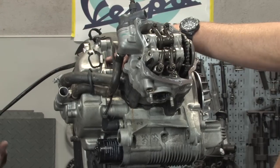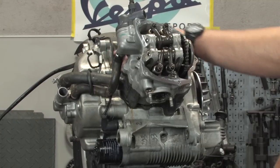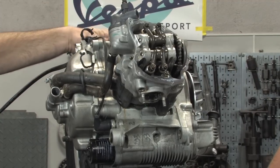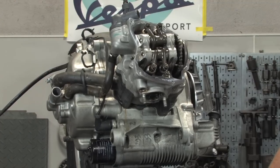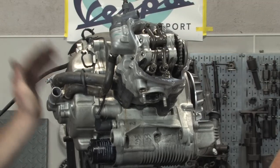We're not getting into it, but there's a gasket here because that stator plate is actually a wet stator plate, i.e. it sits in an oil bath. Yeah, it sits in an oil bath, and the one-way clutch and reduction system for the electric starter are also housed underneath this cover. We're not gonna touch it. We already had this cover off because I overhauled the water pump.